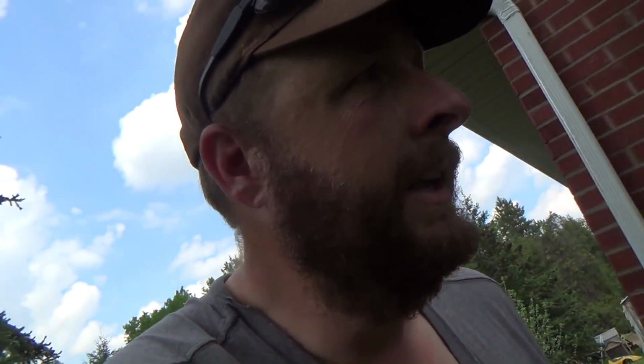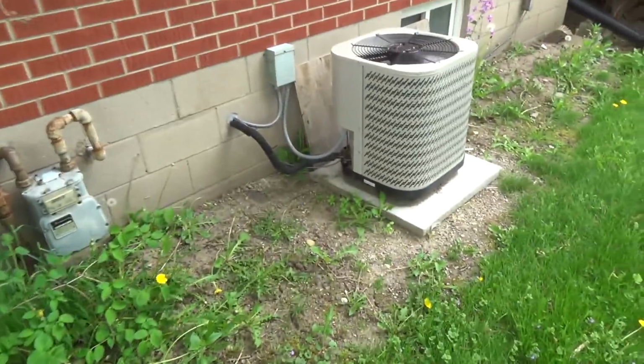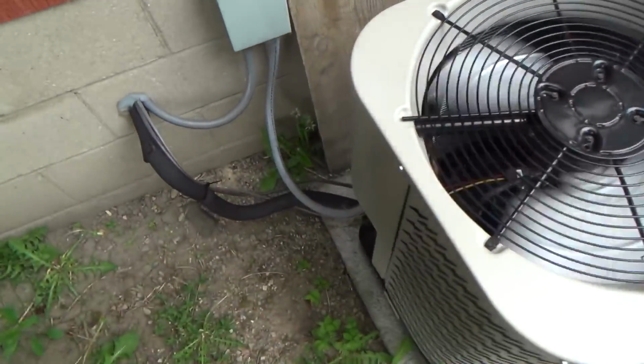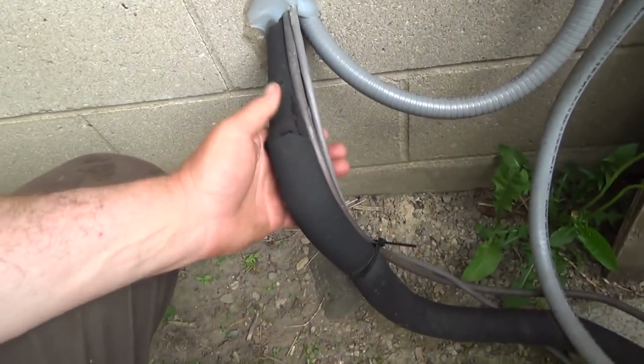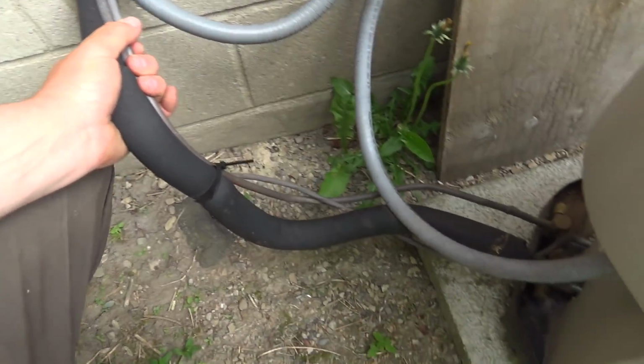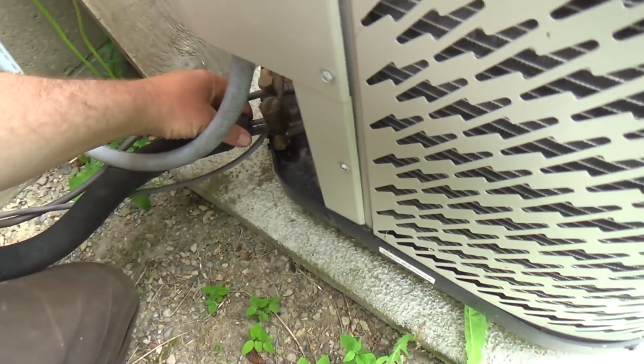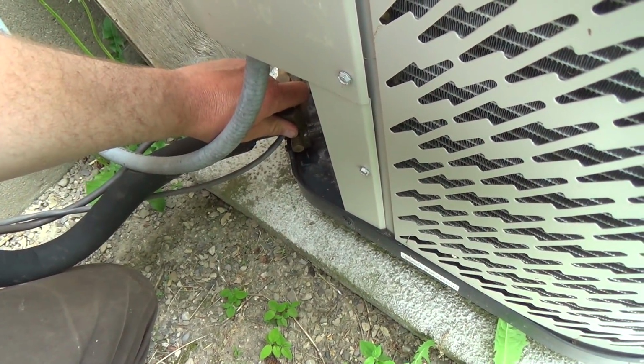I should go over and check and see if the AC is working okay. It's been good. Vent temperature at the evaporator was 46.6 or something like that, so that's pretty cold. Doesn't even sound like it's on right now. Oh, it is on. So she fired up real good. She's pulling out some air there. I have to redo this, they tore all this stuff up. I should get some tape and redo that, because you'll lose a bit of the cool out of there. But yeah, she's definitely cold down there.